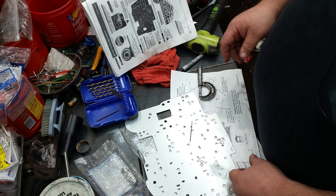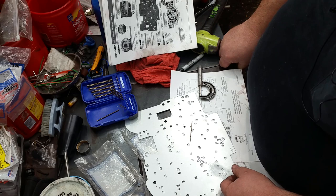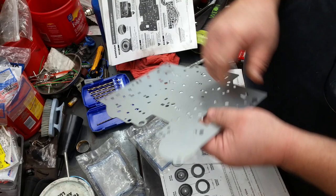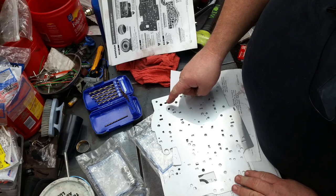All right, since they're saying the same thing, they say enlarge the 3/4 clutch feed hole to match the customer's needs. Regular duty, no plate, no modification to it. Moderate performance, 90 thousandths. TV balance, they want no larger than 1/16 of an inch. Which your TV balance is that one right there. We're going to leave that one alone for now.